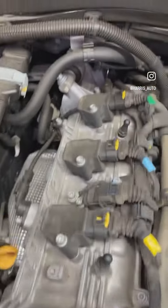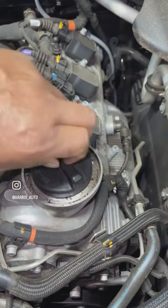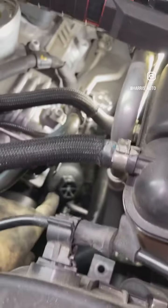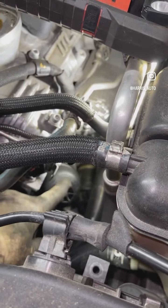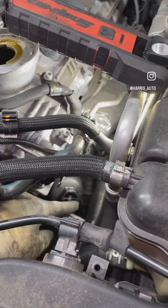Standard V6 — one, two, three, one, two, three. Oil cap — we'll take this off for now because we're going to do this oil change. Right here is your oil filter cap. We're going to get — I believe this is a 30 millimeter — and loosen this cap. Your oil filter will be under this.